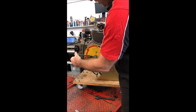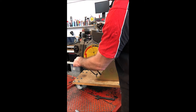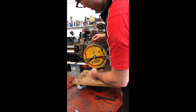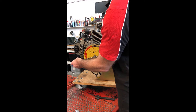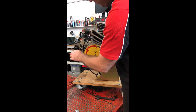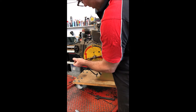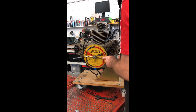Let's see where we stop now — stops at 12. Going the other way, stopping about 15, so let's move our pointer across to about 13 and a half. Using a trusty piece of coat hanger wire as the pointer. It's about 12 and a half going one way, and 12 and a half to 13 the other way — you can call that fine. This engine is quite firm to rotate backwards because of the starter motor drive. We'll call them both 13, so top dead center is now set.